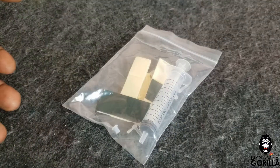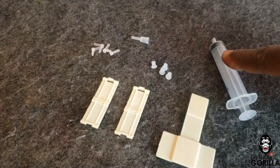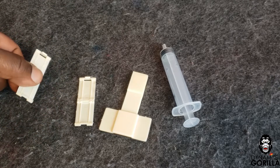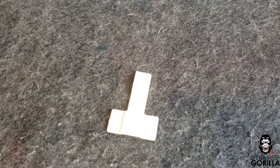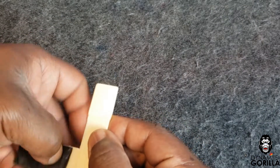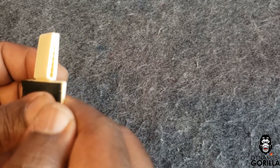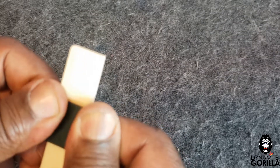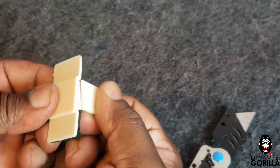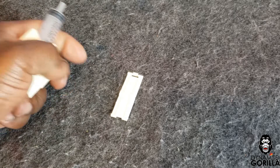In the accessory bag that comes with the Dynamite Gorilla SIS, you'll get four tubing washers, four tubing elbows, a 10ml syringe, a priming clip, a T-style tubing clip, and two clamp-style tubing clips — I'll only need one, so I'll put the other back. I'll modify the T-clip so it's shorter: peel back the mounting tape, slide the clip down flush with the bracket, replace the tape, then using the bottom of the bracket as a straight edge, run the utility knife across the clip a couple of times and snap it off, leaving a shorter T-clip.